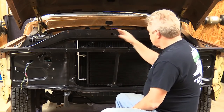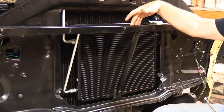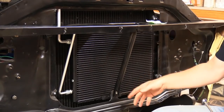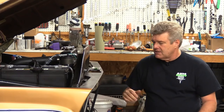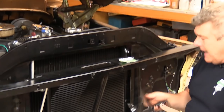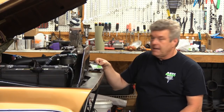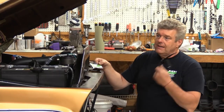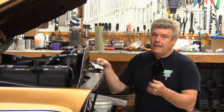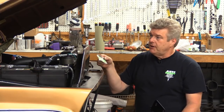I've got this piece in and the top cross brace in. Make sure when you do this that this piece sits outside of this brace here — it could be inconvenient if this gets tightened up and you've got to undo it because it isn't in the right spot. Now I'm going to put the latch assembly on. I'm going to take the latch off of the hood itself in order to do our adjustments. We've got a kit from the guys at AMK through National Parts Depot — this is the hood latch and catch kit.